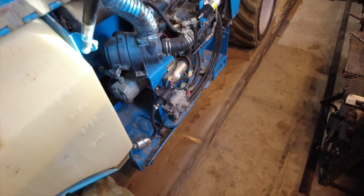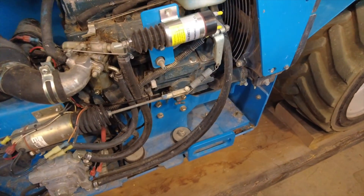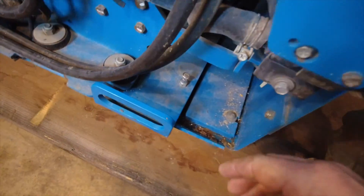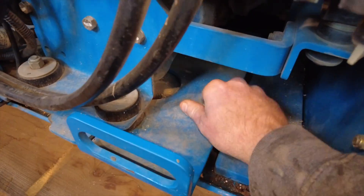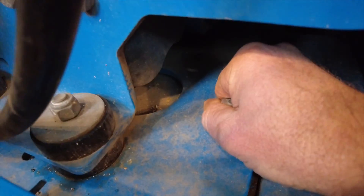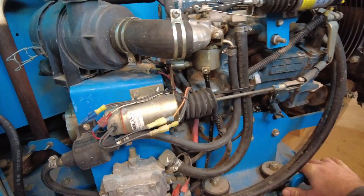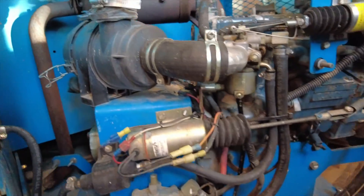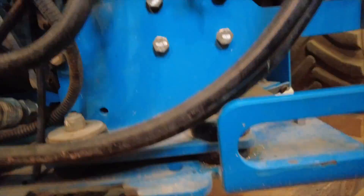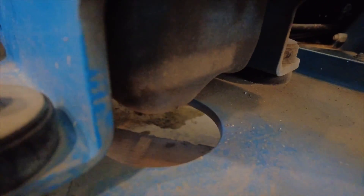An awesome thing about Genies - and I suspect other scissor lifts - I had a Z45 before this that had this same kind of thing. You pull the little pin, screw it a little bit, pull it out, and once you pull that up you can pull on the engine and swing the whole thing out away from the body, which makes it super easy to get to.